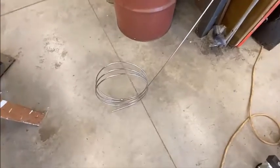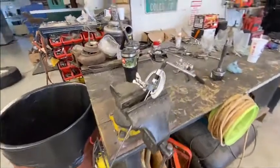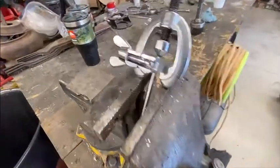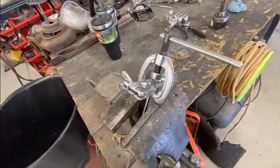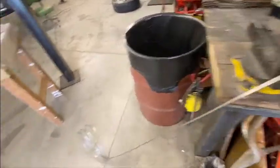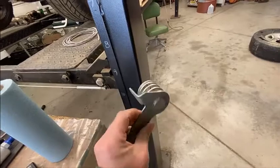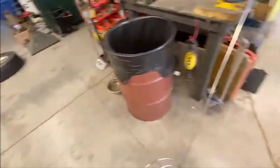This is how it comes - it's coiled stainless steel quarter-inch line, which is what we're going to be running to the back. You've got to put your fittings on first, which is why this guy's hanging down here. Then you flare your own ends. There are better flaring tools but this is the one I use just because I have it accessible. Once we get it in there we'll start making bends with this bender here - that gives us our 90s, 45s, whatever we need.